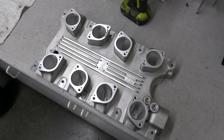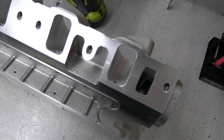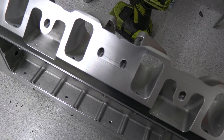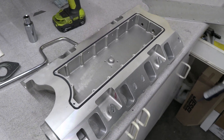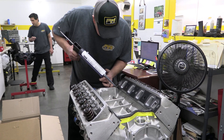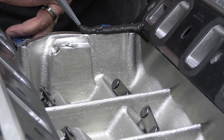Now we can get to just what might be the coolest part of this build — the Borla Individual Stack Injection System. This is the plenum casting, which looks old school, but it's actually a brand new casting with several updates to accommodate modern EFI like a MAP sensor and idle air control. The underside has a large pocket hidden underneath — that's actually a balance chamber, and its purpose is to help equalize all the intake pulses from the eight cylinders to help the engine run more smoothly.